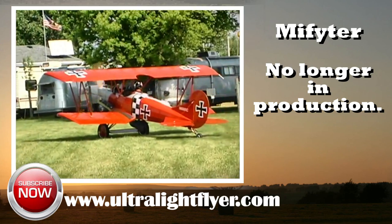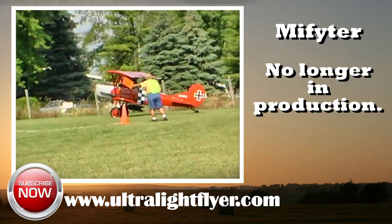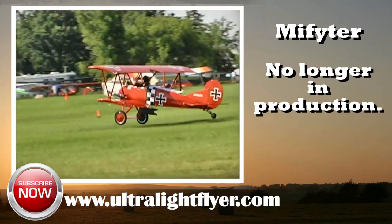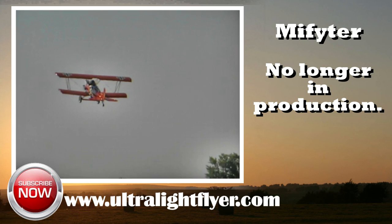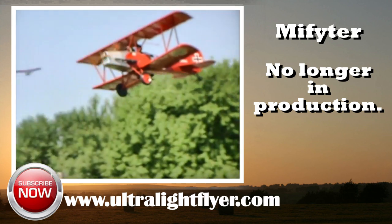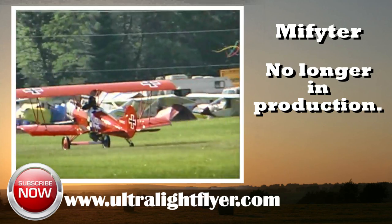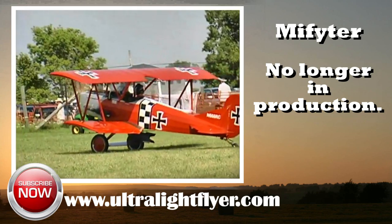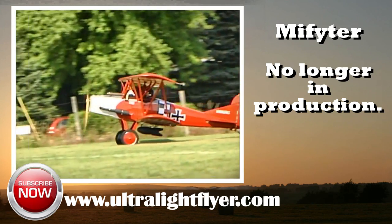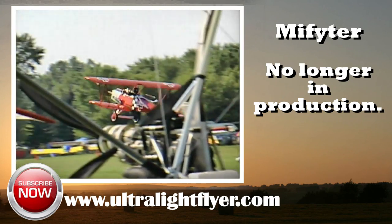The kit that we've got here sitting in the box — what does that consist of? You're going to get everything in the kit that will build the airplane, less an engine, prop, and instruments, which I think is kind of standard in this industry. There's going to be everything there — all welded construction, bolt-together construction, a little bit of woodwork on formers and fairings. You've got a little bit of metal work to do, but it's very straightforward. All the patterns are going to be there. If you can build a model airplane, you can build this one. Time-wise, I'm going to say from 650 to 1,200 hours — if you're really sharp and know what you're doing, you'll walk through this at 650 hours.